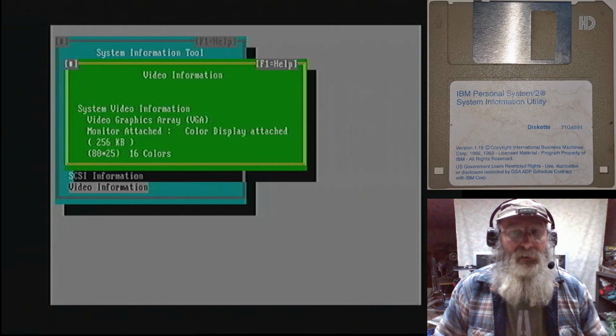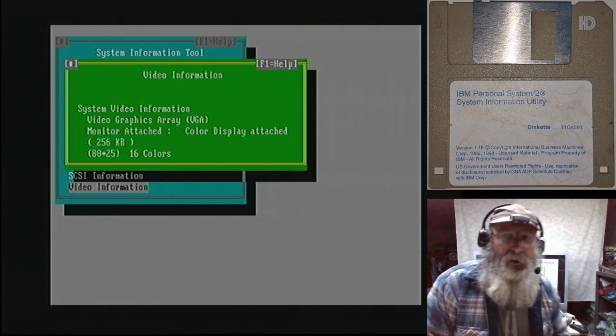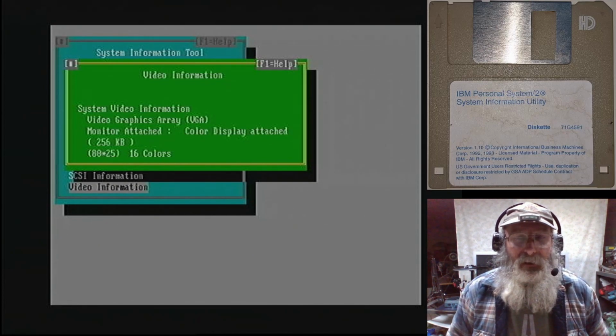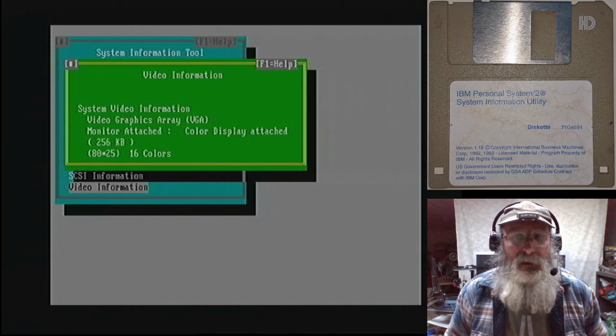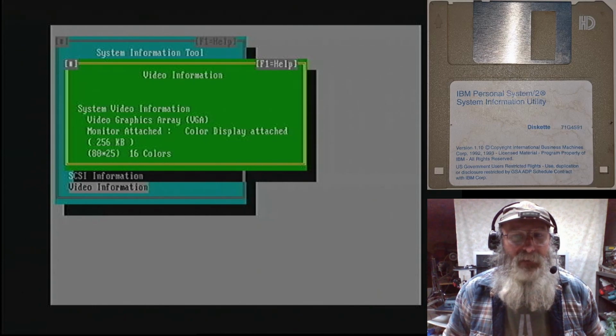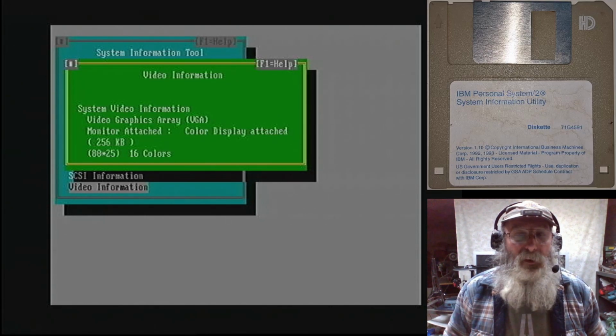In this case, the Model 30 that I have here is actually so overloaded. I call it the Max 30 because it just has every little thing on there, with all those adapters for the SCSI hard drive, which certainly has a power draw. The external diskette drive, even though it's externally powered, has its own power supply in there. I have multiple adapters in there, and a floating point coprocessor, as I said, 8087. With the electrical use, I'm really getting the VGA adapter being primary to that. There's a lot more power draw from this Max 30 than I had with that other Model 30 system.